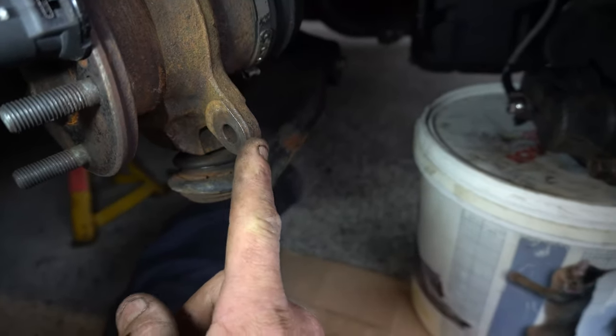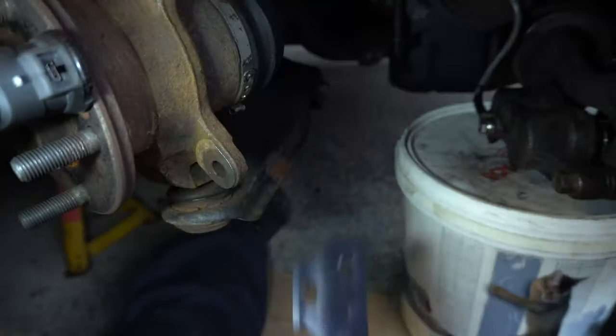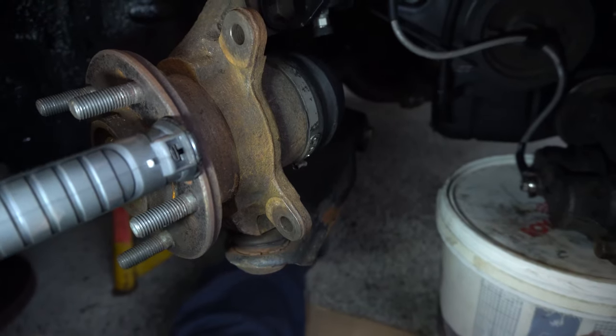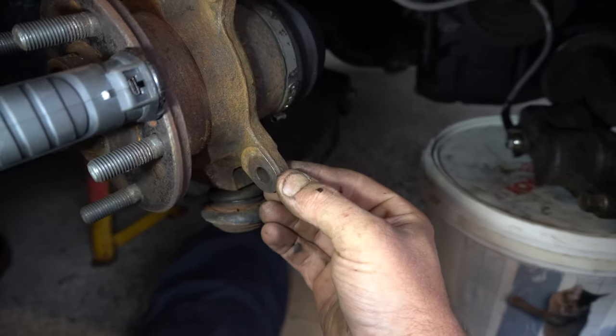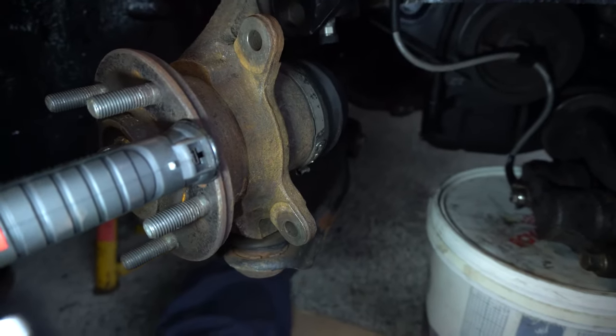That will give me enough clearance here to get this bracket to sit all the way in and to bolt up nicely. It feels like it would bolt up now, but it would be forcing it a little bit. So if I just take the tiniest little bit of metal off of there, it'll allow that whole bracket to sit inboard slightly and we'll get it bolted up.